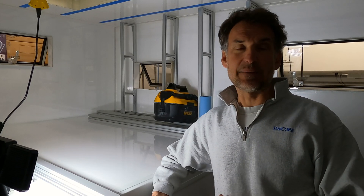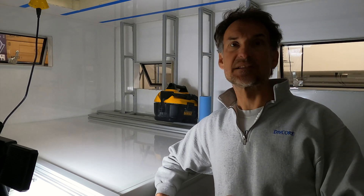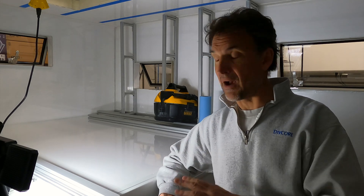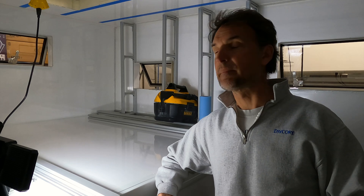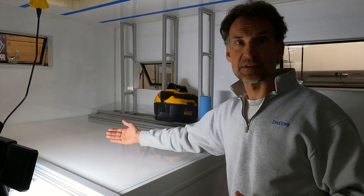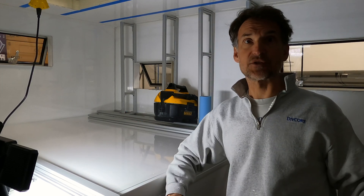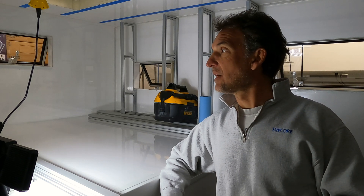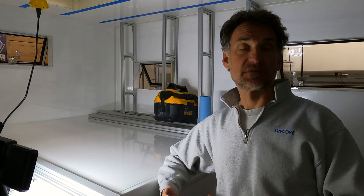The dinette table is already built. Its tracks and carriages are very precise — they do not have any play in them. They literally have to be mounted within a millimeter of each other and perfectly parallel. I want that dinette table to slide out right in the center of the dinette area, and I want the bed to slide easily back and forth without restriction, because if the tracks are slightly not parallel, there'll be resistance. It has to be mounted exactly perfect.